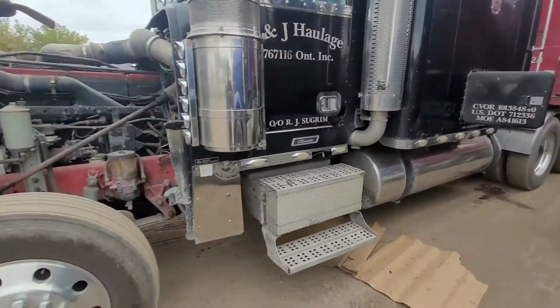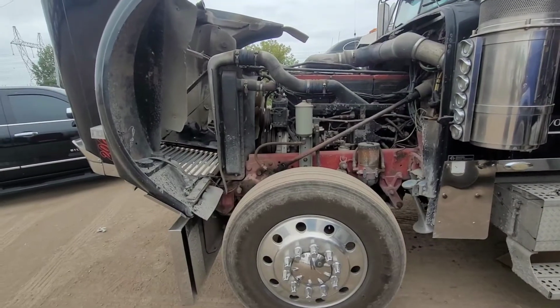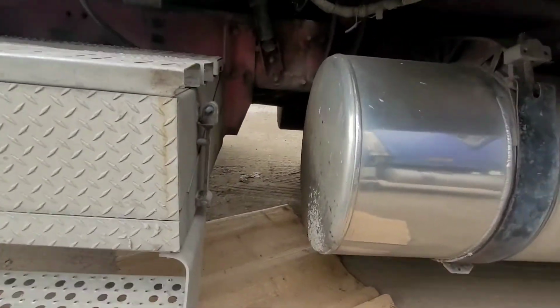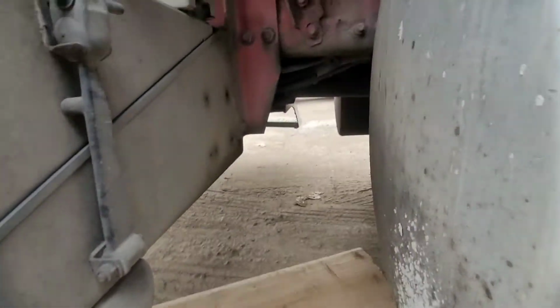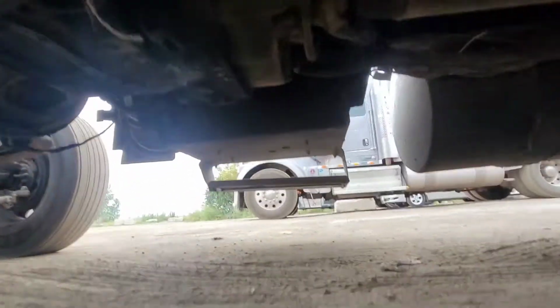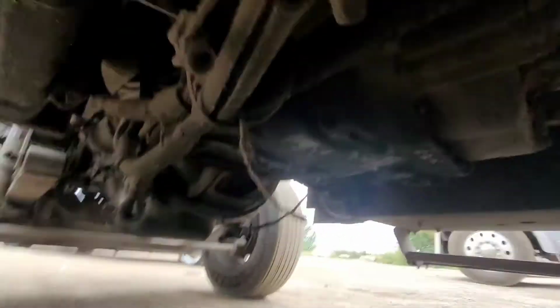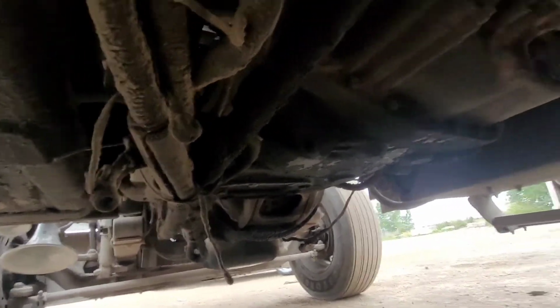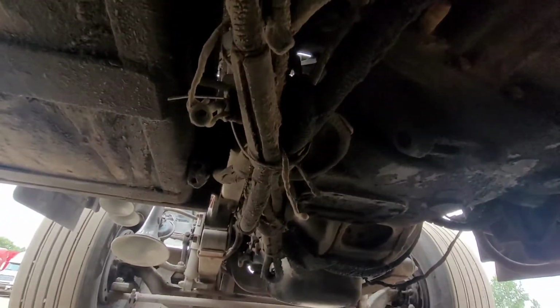Smokes a little bit like every normal real diesel engine, but just a little concerning. So I'm gonna go under here and check tranny level, make sure we're good. While I'm down here, I'm gonna go grease her up, grease the drive lines up, and make sure they're all nice and tight. Want no drive shafts flying out on the road.